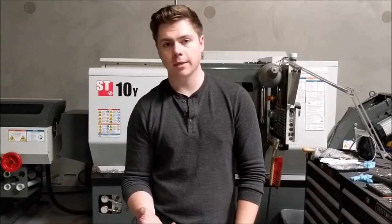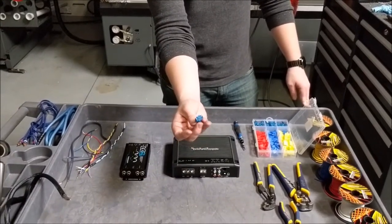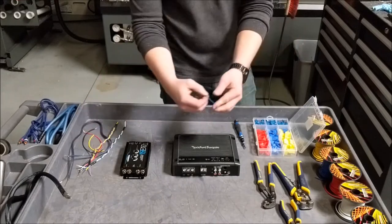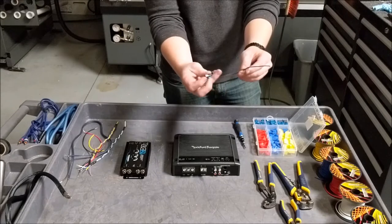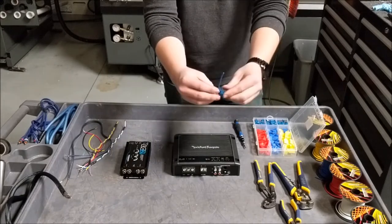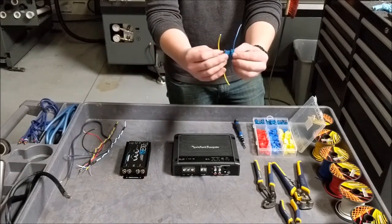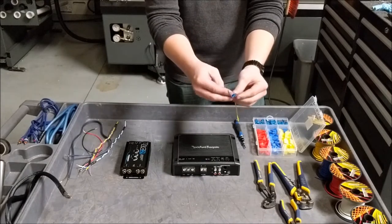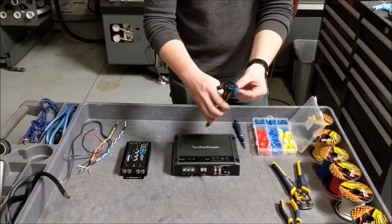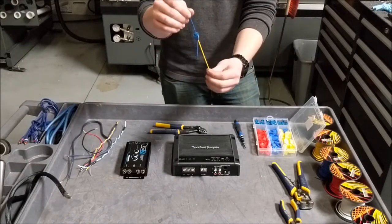We're discussing the wiring of your Rockford Fosgate 500 watt amp and your LC2i controller to your Tesla Model S sub system. Let's first talk about the mid splice connectors we're picking up to your door speakers. They're little solderless, cutless mid splice connectors. You're going to grab your speaker wire that you're going to tie into, take your mid splice connector and push it all the way in. There's another channel running parallel that your signal wire going to your LC2i controller will only go in one way — find out which way it goes in. Once you do that, grab your pliers, crimp it down, get your case cover, and shut it down. Now you have a good signal without cutting or soldering any of the wires.